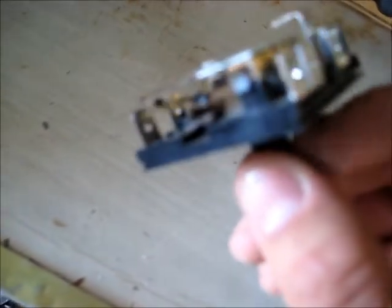Here's that switch out of that oven I'm going to place in another video. As you can see, that contact - this camera can't keep up with that contact - it's burnt out. Now I figured out how this thing actually works: there's this thing in the back here that connects on this little - must be some sort of resistor type thing - and it bridges between this terminal and this resistor. There's a hot plate; it's on, it self-regulates current, and that gets hot and pops off.